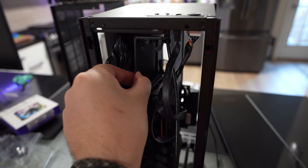The RGB will actually show through and make its way through all of that mess — I know you'll barely see it, but just having a little glow there I think is nice. I mounted the fans to the back plate using nuts and bolts, bolted onto the other side. I'll include the links for the nut and bolt in the description. The NZXT 140mm fans fit perfectly and the nuts and bolts line up with the mesh grid. I'll just have the wires going down the side and then up through the back, giving enough slack to reach the RGB fan controller at the top.